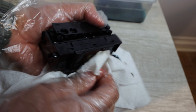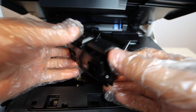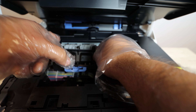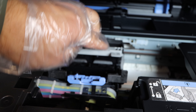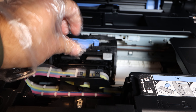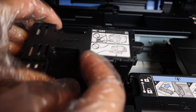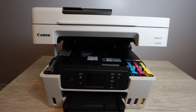Once you're satisfied and done pushing through the cleaning solution, what you need to do now is clean off the print head and make sure it's totally dry — you are not installing the print head yet. Wait 24 hours. After that 24-hour period has transpired, you can then bring the print head over to the printer and reinstall it. It is vitally important that you do not install a print head that is moist, wet, or has any liquid or condensation around it. Dry it off with paper towels, paying special attention to the back motherboard that connects to the printer.